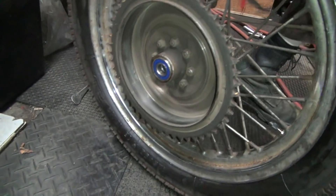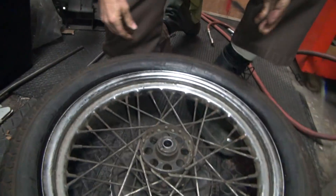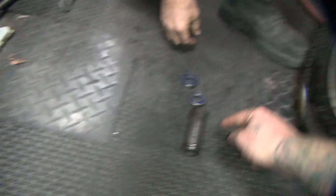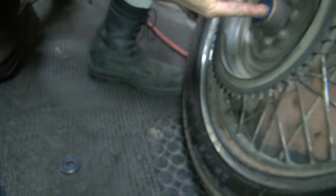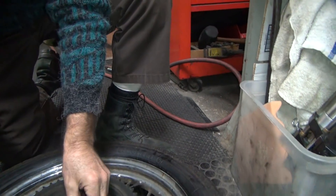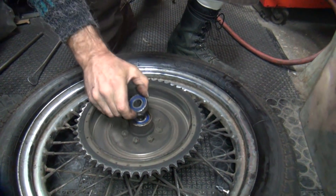So now it's on the inside and not in the middle between them. Yeah, there's your washer — we got a bent washer. It's alright, it's a bent one so we don't care. It'd be nice to have a washer in between if we're supposed to have one in between there. You know what that washer does? It makes the bearing not hit on the outside, but on the inside where it's supposed to.